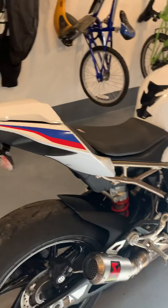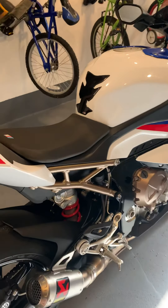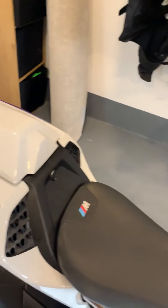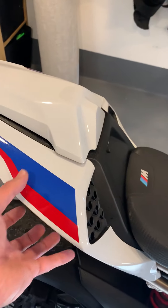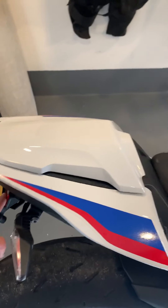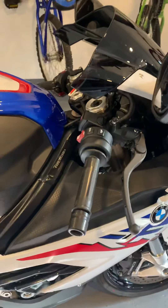All I've done is put a tail-tidy on. Took about 25 minutes - pretty easy really. You just take the cover off, these panels all come out, two bolts and then they just unclip. There's a plug here, same on this side - two plugs, a few cable ties. Everything comes out and I've kept the original light and the original LED for the number plate, which stops any alarms coming on.